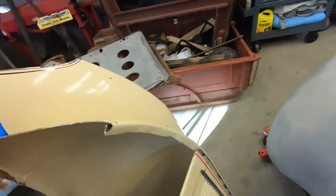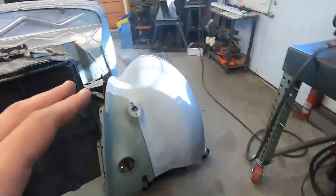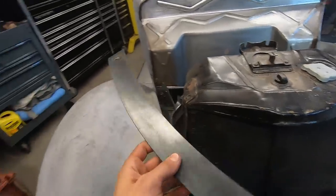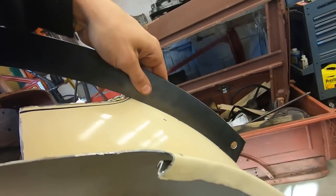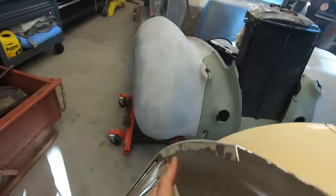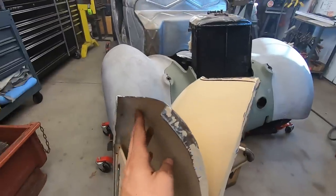All right, so what I'm doing now is adjusting this flange. I already adjusted this one on this side. I'm taking one of my radius gauges that I found fits the hood to the grill nicely, and it's pretty close already. You see how this light behind the, just the tip area? And on this one, it's nice. It touches all the way around. This is the one I already stretched, and I couldn't use my new invention on this one. It didn't fit in here with this tight curve. I couldn't get it in there.